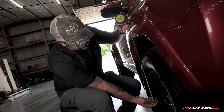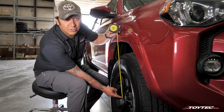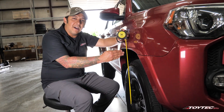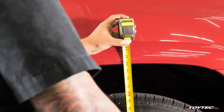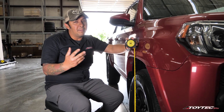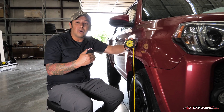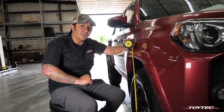When you're measuring your front end, you want to measure from the center of the wheel hub or center of your axle to the bottom of your fender. Most Toyota trucks have a baseline of 20 inches on the front end. This is a perfect measurement to let you know that after you install your coilovers, depending on how much lift they will give you, you can set them up accordingly — or if it's a full three inches, we know that our magic number will be 23 inches.